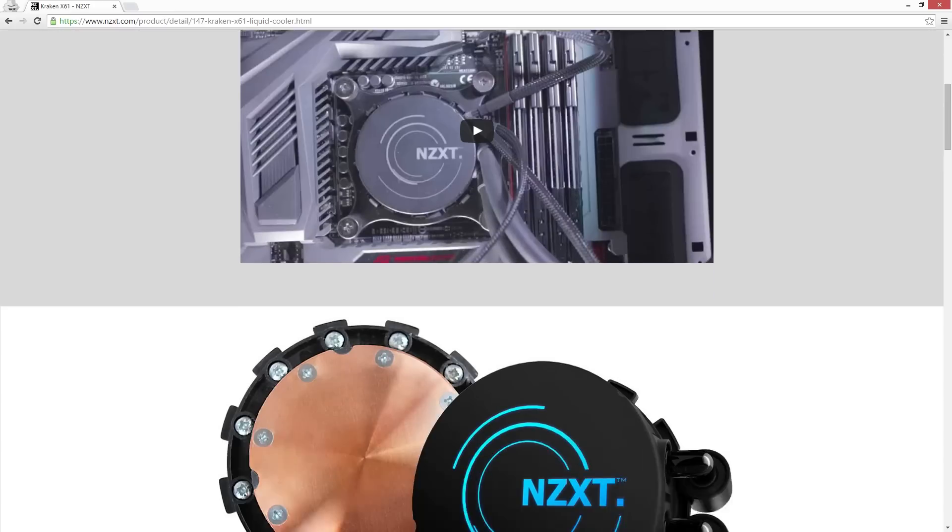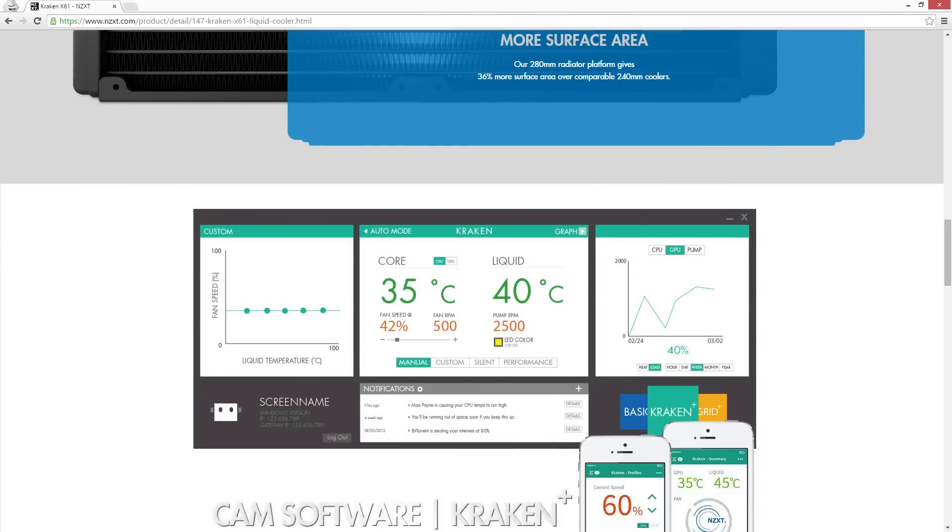4.8 GHz is an extremely rare outcome. Going from the i7 Skylake's stock 4.0 GHz with a 4.2 GHz turbo to something like 4.5 or 4.6 gives you about a 50% shot. At 4.7 the fall-off is really rapid, and 4.8 is going to be pretty rare based on the data we have. For the Z170 Extreme 7, with our CPU we hit 4.7 no problem, using the NZXT Kraken X61 liquid cooler.